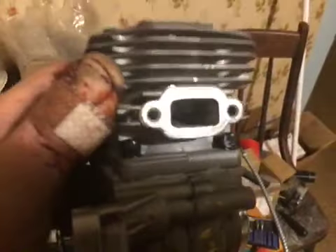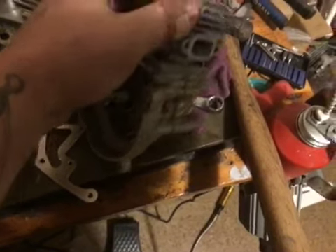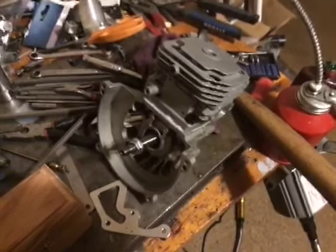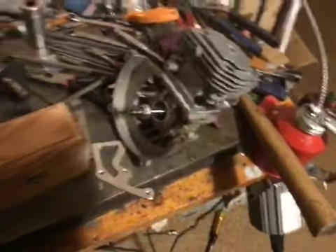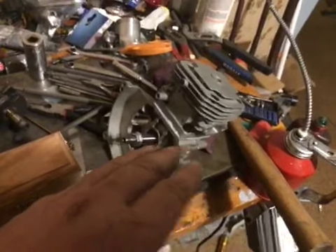Added an intake notch for added intake duration. Widened and shaped the exhaust for performance rather than the standard shape they come with, which isn't really for performance. Got the intake duration nailed right where I wanted it — right where me and Fiskale Ripper tested and his ran like a monster. So we got a good setup now for these piston ported 36s, 37s, or 38s I can make out of them without the jug, because I have a 2mm stroker crank that we custom make.